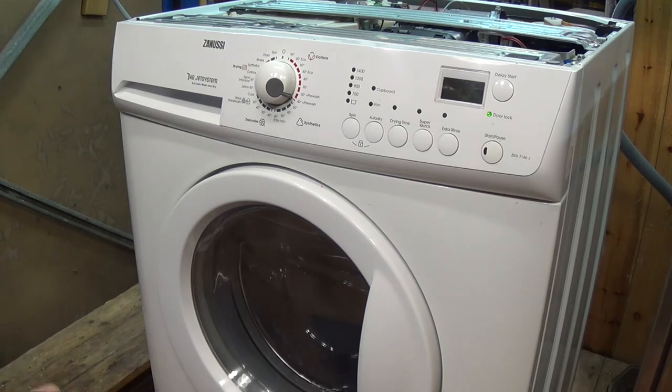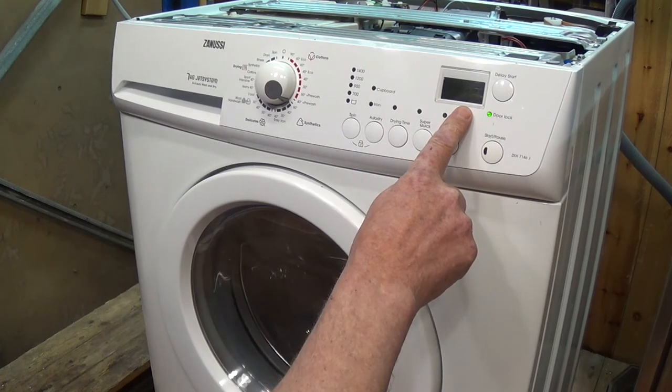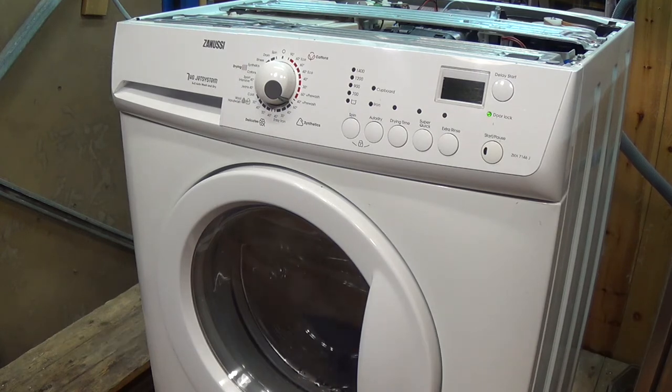The next function will kick in the dryer. It also does the door interlock and the fan — I'm fully aware this machine has a noisy fan motor. The fan will start running and it will show us the air temperature on the two sensors inside the machine. It will start to do its normal dry cycle, rotating one direction and then the other. After water condenses, it is pumped out using the conventional pump, and the solenoid valve at the top will be intermittently on and off with the condenser.